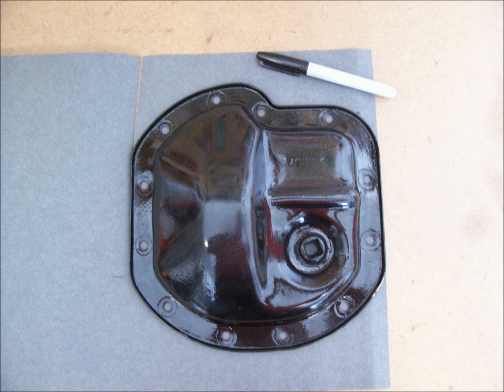I was extremely disappointed to find that the new cover gasket I had ordered did not fit. Once put in place on the cover with the bolt holes paired up at the top, it was obvious the gasket was too short, and the bolt holes did not line up at the bottom. I would have to remove too much gasket material to open the bolt holes, rendering the gasket prone to leak. So, into the trash it went.